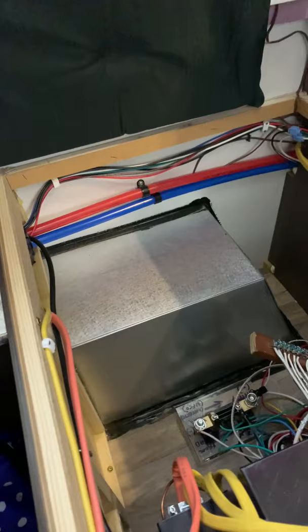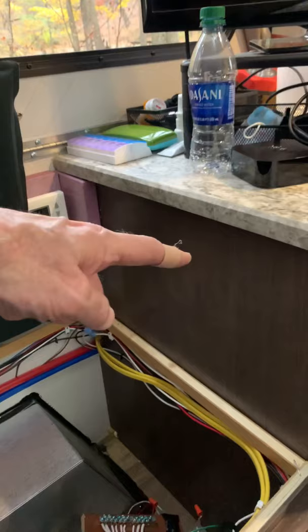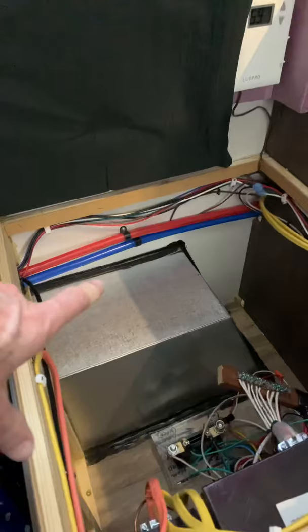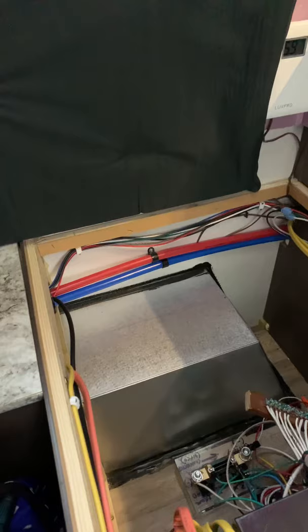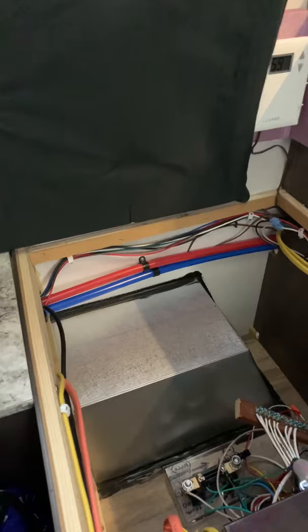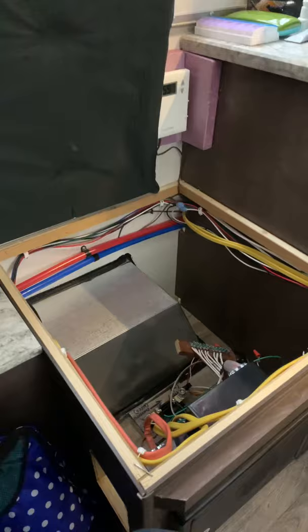I popped the top here — a quick look at why we can camp all year long. These are the hot and cold water lines; there's an 11-gallon fresh water tank and a hot water tank back here. The lines run by the hot water tank, behind the refrigerator, by the propane stove, and to the sink. Using the remote temperature sensor when it's in the low 20s outside keeps the water from freezing. The Thetford cassette toilet water tank sits right by the seat inside the cabin and stays at cabin temperature, so we've had no problem with it freezing either.